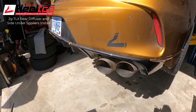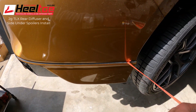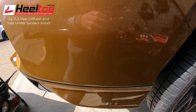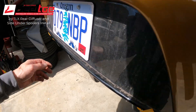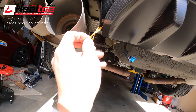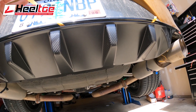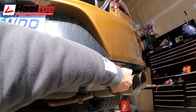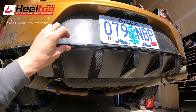The bumper's back in place and now we get to do the fun part - satisfyingly peeling away the adhesive backing from the tapes and then giving it a final push against the body of the car. This tape really activates with pressure, so it's good to have some pressure on there to really get it to bond and make a nice permanent adhesion. Pull this away - nice, nice, nice - and it's perfectly in the exact right place on the car. Alcohol cleaned it, it will stick and not want to come off.